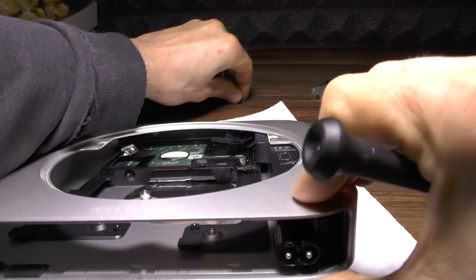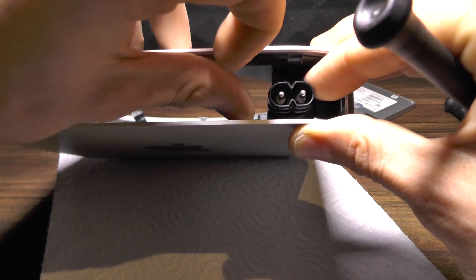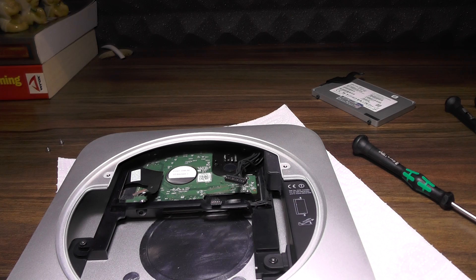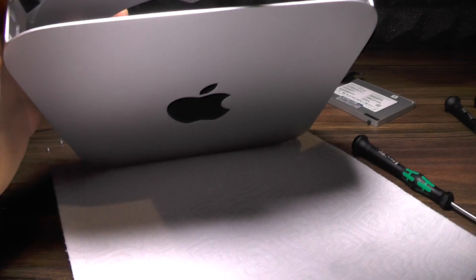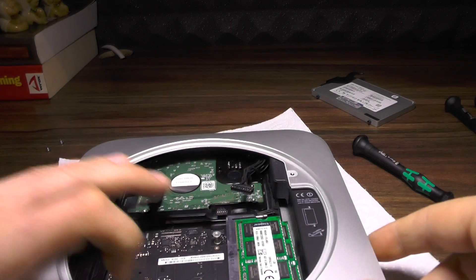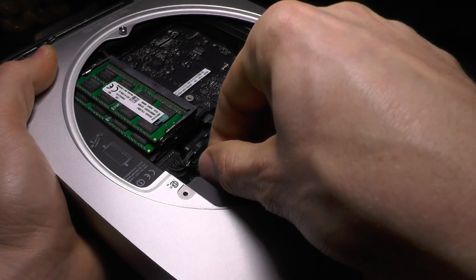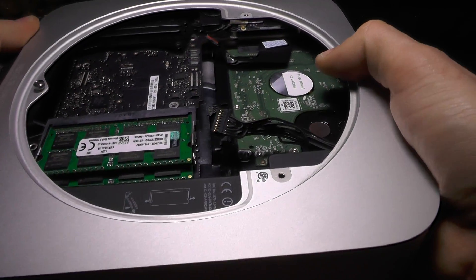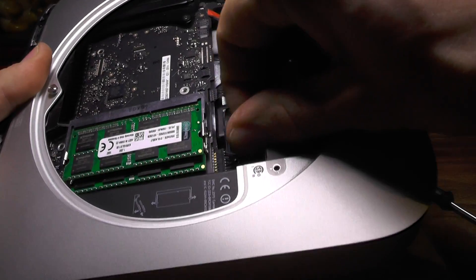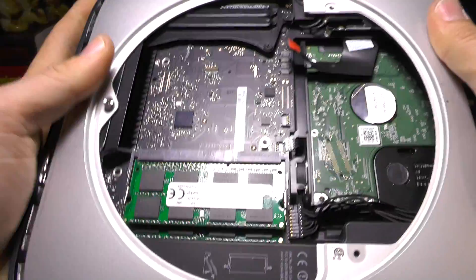We need to put that safety pin back. Bear in mind that this safety pin loses its flexibility over time, so you should always check whether the pin is doing what it should — sometimes it will fall off and then all hell can break loose. Once this is inside, push it a bit further in and connect the power supply jack.